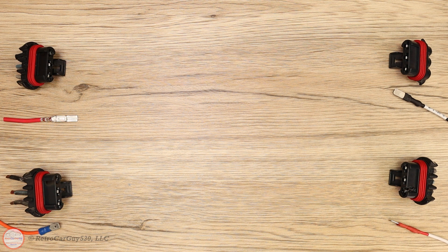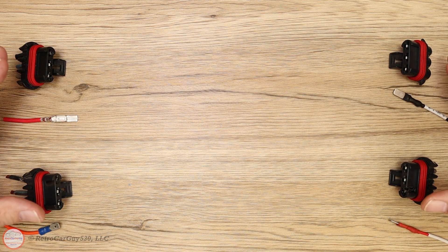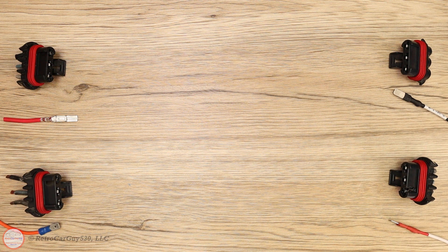One of the most common failures in an electrical circuit is where there are wire splices or connections. The terminal connectors within those connections often can fail or expand over time due to heat or high amp draw through them. Here are some examples of failed ones from the Chevrolet SSR for the electrical connection for the main cooling fan. They have very common failures, but it's not limited to just the SSR cooling fan situation.